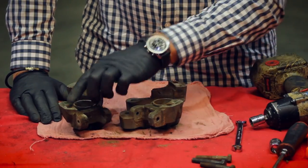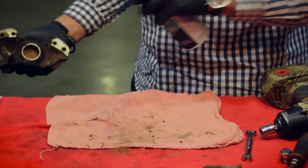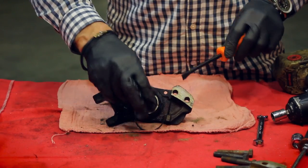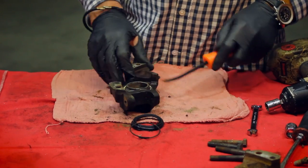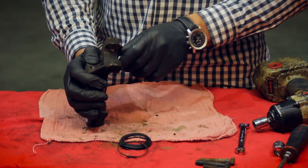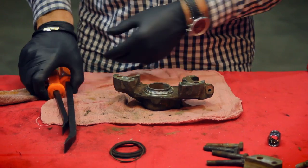The main difference between the rear caliper and the front caliper is there is no channel and no O-ring to be concerned about — it's essentially the same process. Pop off the retaining ring, take it off, and we can see the piston. To pop the piston out we can use the same pry bar method or apply air pressure into the line, plugging off one hole. However, this piston is really solidly rusted inside, so we're going to use the pry bar method.